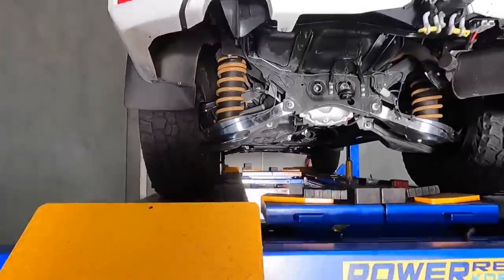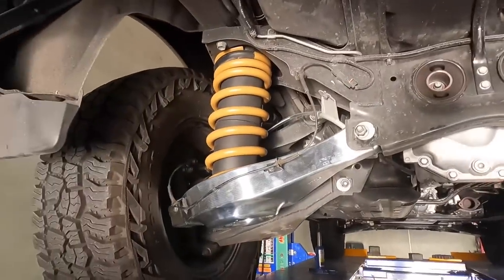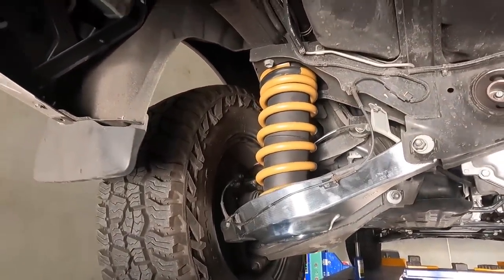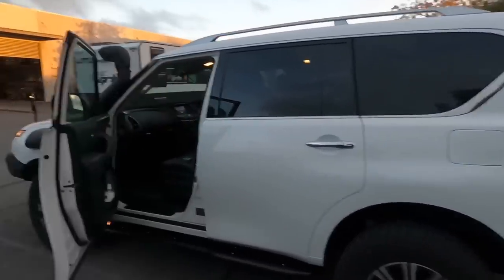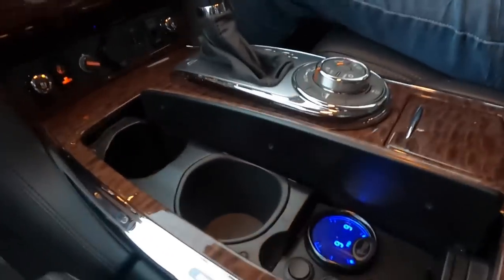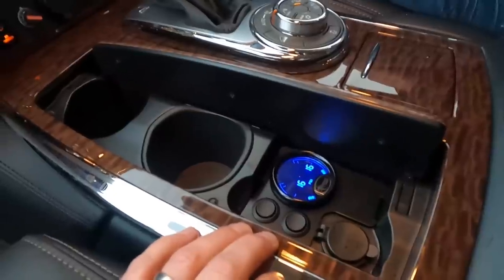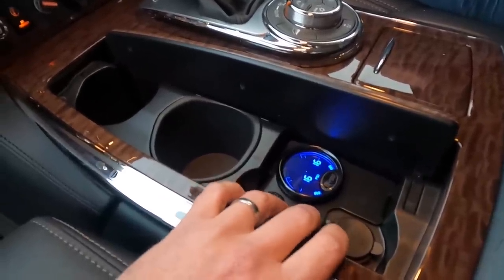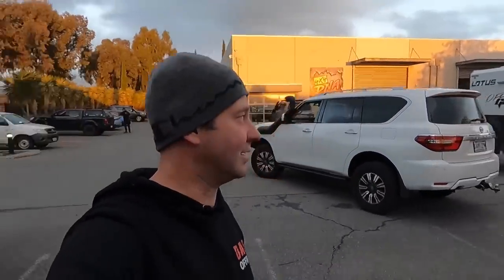Here's the finished product - looks good in there, black and gold. As I said, this is for a lifted application - you can't do it in a standard height at this time, we're working on it, but how good does that look! If you've gone that far, there's probably one other thing I'd recommend - on-board air. A compressor so you can manage your airbags. Before you drop it on the ball, pump it up to 50 PSI, check if the car's looking level, then adjust to the appropriate height, all from a control inside the cabin. If you're sick of airbag leaks as much as we are, get yourself some Dash airbags and never have to worry about it again - because they will not leak.